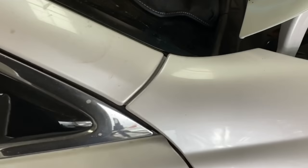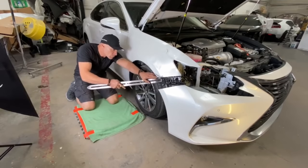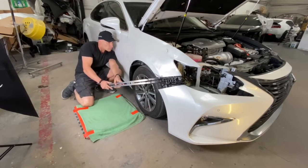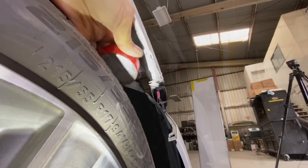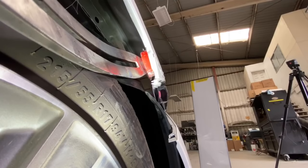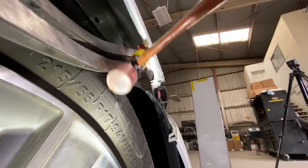Now moving on to my next layer of complexity. Lining up the nose section with the flat bar. I'm going to place the bar behind the back side of the bumper bracket and push off the tire. I'm going to use the bar in conjunction with the body repair dolly — hammer on dolly technique to remove the buckle in the edge. The fender is slightly buckled outward. Applying pressure to the back side of the dolly, reaching for my plastic tip hammer and striking the buckle. Next, knocking down the underside buckle.